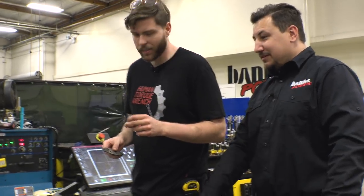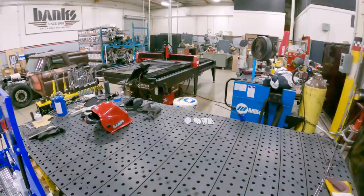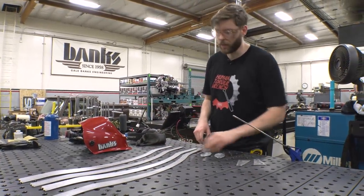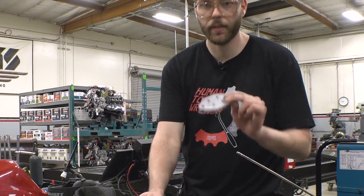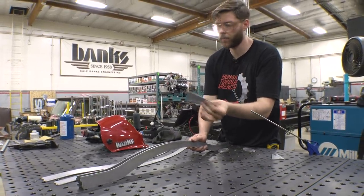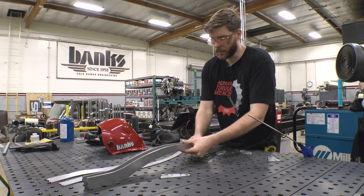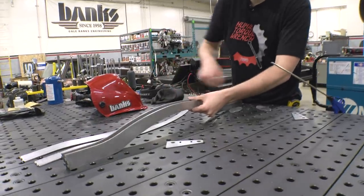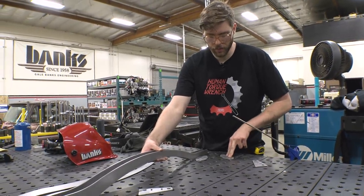Hard cut to me grinding again for the seventh time this week. We've got the main structure of our design for the core support spreaders. There's going to end up being two of these per side. We've got our cab-side bracket landing up here, our hinge-side bracket overlaying on our reverse hinge bracket that lands on the core support — we're going to sandwich in front of that. The piece I have yet to cut is going to be 14-gauge overlay that I'll lay across the top of this entire thing, weld that entire seam, and blend it out. It'll be a nice organic tubular-looking structure that's really stiff and removable.